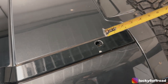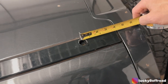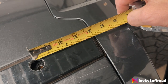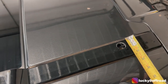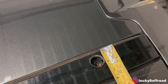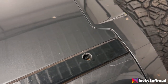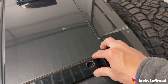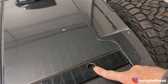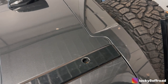You're going to want to drill a three-quarter inch diameter hole, four and a sixteenth from the end of the trim piece. And you're going to want to drill that hole also at three-quarters of an inch on the diagonal here. If you're slightly over, it's not going to be a big deal. Water is going to get under here anyway just by design. As long as that bolt is in place, you won't get any water into the truck. So drill that out first and we can move to the next step.